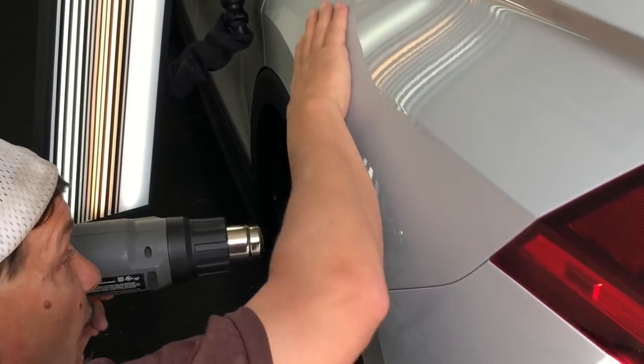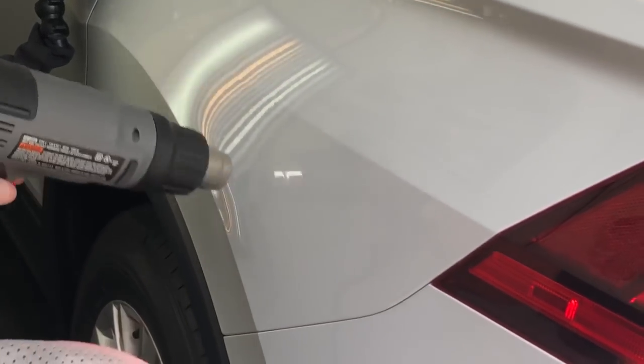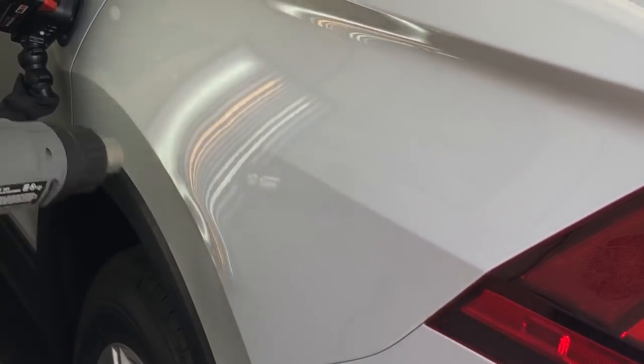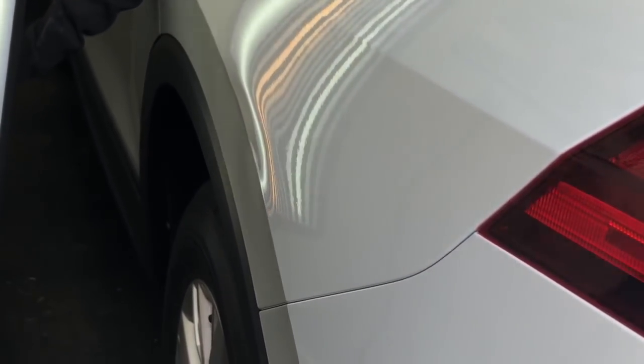It doesn't look like there's clear guard, and it doesn't look like the paint actually scratched all the way through — it scratched through the clear on top of the paint. So when we get done with the dent, getting this line out is our main concern. If we can get this line out and this brow out the way we want, a good detailer might be able to wet sand and polish that out. But like I always say, that's not this guy — I'm not going to be wet sand polishing on somebody's three-stage pearl white. It's really nice paint.